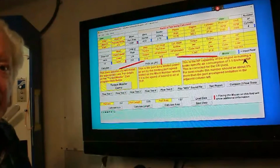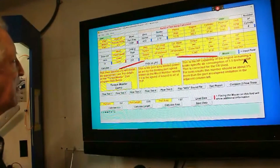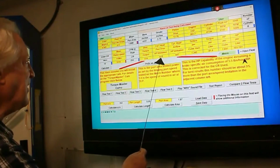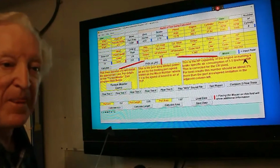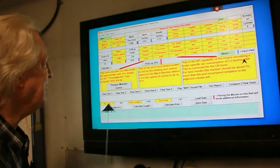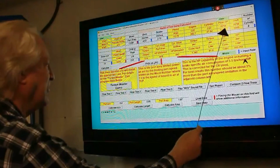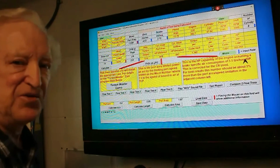Now these heads are intended for a guy who wants to build a 383 for the street, wants peak power at 5,800 RPM. Well, with this port area and this flow, our peak power is going to be at 5,145 RPM. And based on the area, it's going to be 443 horsepower and 514 foot-pounds of torque, right? He wants to see something near 500 horsepower, and from experience I can tell you that's a very doable figure. So what are we short on? Well, we need to increase the port area and we need to increase the flow for him to be able to hit his targets there. Right, so that will be our next move, is to look at what has to be done to these ports.